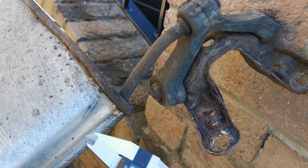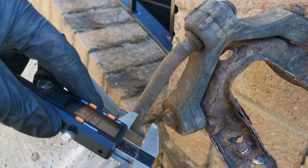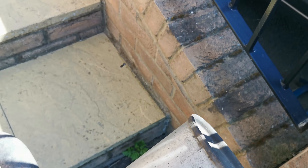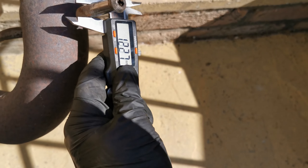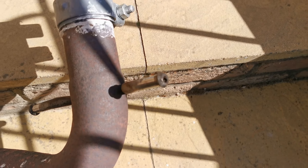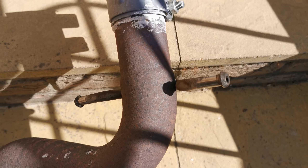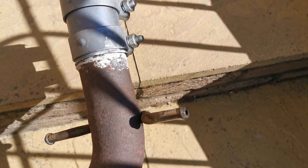Now the exhaust is off, there's one thing I didn't measure yesterday. We've got our trusty callipers back again. I'm just going to measure the thickness of these, which I think is 12 mil. You can see it says 12.44 mil — that's 12 mil pipe. I'm just going to double-check it against these centre ones. 12 mil. So yeah, we need to replace these — these ones won't fit on the aftermarket exhaust I'm going to build. So I've got to change them and order the correct size. But now I know the size, that's brilliant.